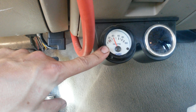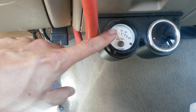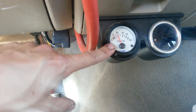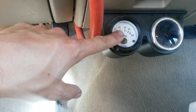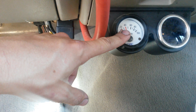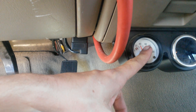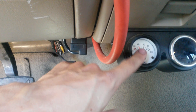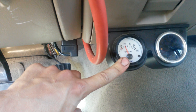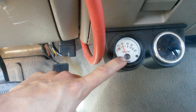Most people that drive responsibly and don't let their tank get down below the E — most people are going to want this for when they change their fuel filters. You'll notice when you change your fuel filter, when you first turn the key on, this isn't going to get up to where it should be — it'll probably be between 20 and 40. So you want to keep cycling your ignition on and off until the pressure gets up to at least 50. That means it's purged a lot of the air out of the system. Honestly, the fuel pressure gauge is mostly good for changing your fuel filters, which you should be doing at least every three months or every 10,000 miles.